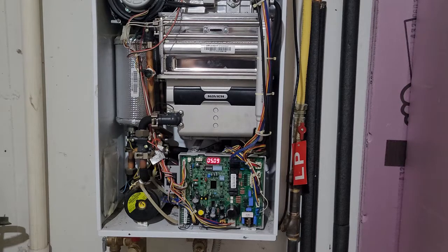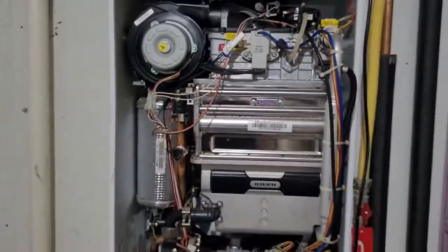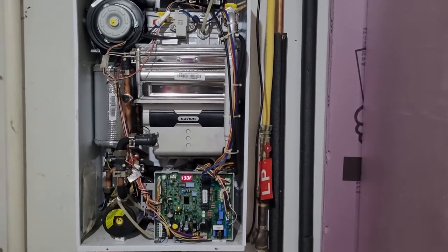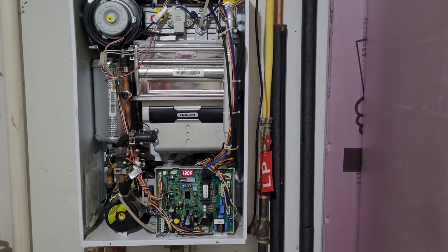After you're done there, it's ready to go. Turn the power back on along with the gas and water pressure, and flip the switch to see what happens. As you can see, mine will go through some self-checks. The burner did kick on — you can see the flame in the little glass window — so at this point we're in pretty good shape. Wait for the burner to go through its cycle; once it heats up the water in the hot water heater it'll go ahead and shut down, just to confirm everything runs properly.